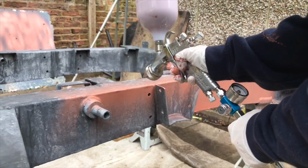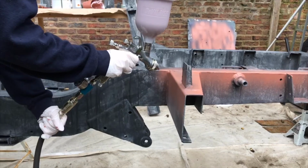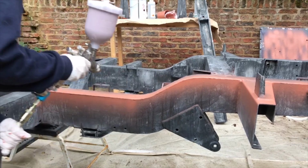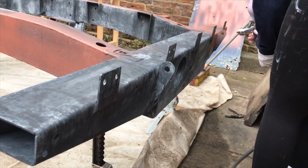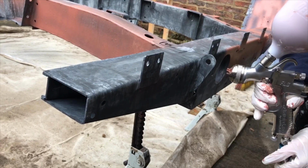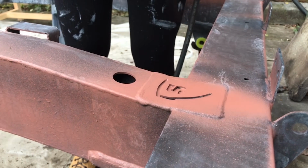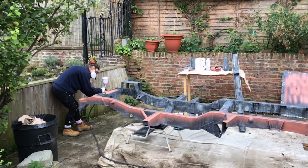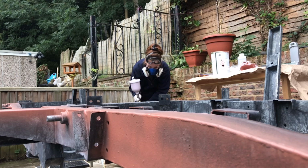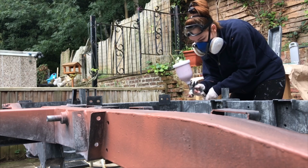So I'm starting off with stripe coating, and all that means is that the edges get that first layer of paint. The primer and top coat do actually recommend stripe coating, so I'm just doing as the product recommends. Feel free to follow me if you'd like, if you're doing a similar thing, but this is just what I'm doing. This method just allows you to apply paint on those high wear areas, so edges, little brackets, things like that that are probably gonna maybe get chipped or that need just a higher and thicker layer of paint laying on them first before you fill in the gaps.